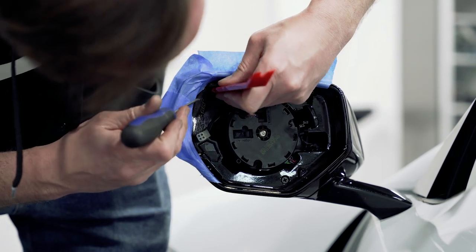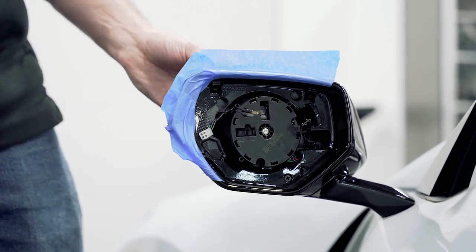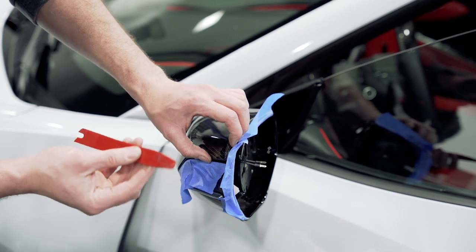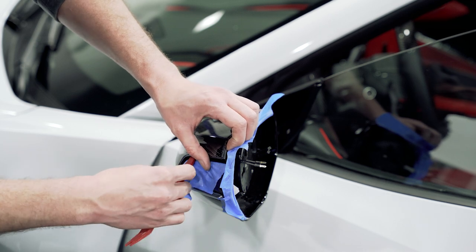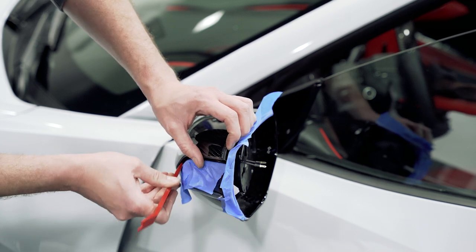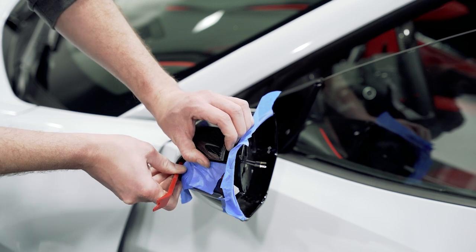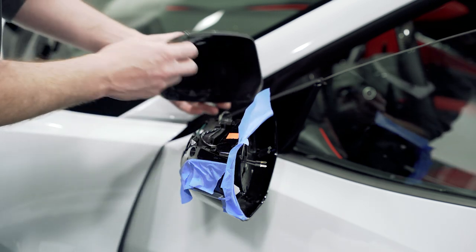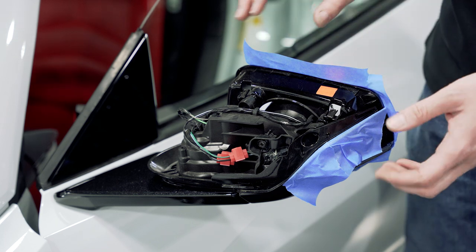We'll double check this one. Now we've got that released, we just need to release the clip on the outer edge. Now that the top edge is free, you can see we can kind of move this corner up and down. Take the plastic pry tool, insert it underneath, and slide it down this edge. When you get down to where the light comes across, slide it in and wiggle the mirror around a little bit and it just pops right off. Do this in a warm environment so the plastic clips don't break. With that off, we're going to start removing some of the pieces around the side marker light.